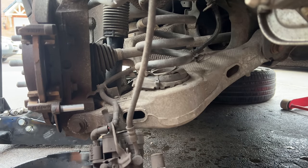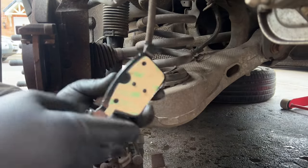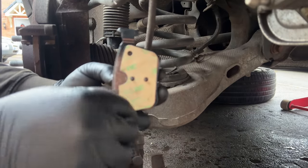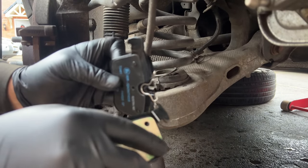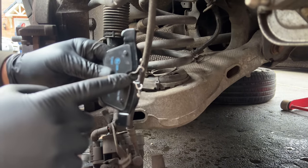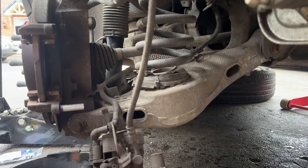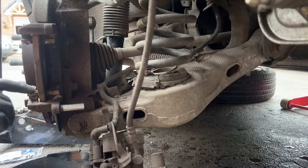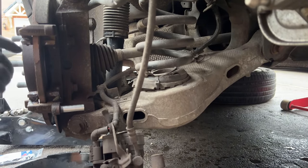Let's get the new pads out of the box. It's quite important — you have two different brake pads, inner and outer. For the outer one there's an adhesive pad on it that sticks to the caliper itself. For the inside pad there's an anti-vibration clip that presses on the inside of the caliper to apply pressure. On the driver's side rear, this is where the brake pad wear sensor fits — important to remember that. Next, grease up where the pads slide — not too much, just enough to enable free movement. I'm using Ceratec grease.